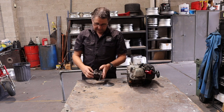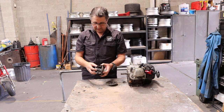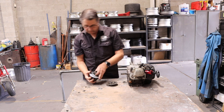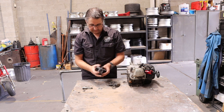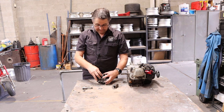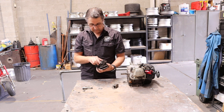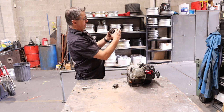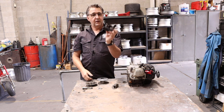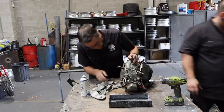Before we start that, I thought I might show you this little gadget. This is a CVT that goes on there — centrifugal CVT, quite clever actually. So as this spins, these weights fly outwards and push that, with that spring. As that spins, it pushes this one inwards and changes the ratio. The belt moves outwards and it gives it a higher ratio. Prehistoric CVT. Centrifugal CVT. Press steel and bits of metal. Simple and effective — these are a pretty simple little gadget.